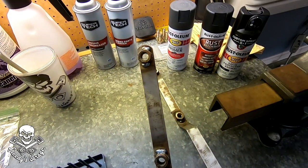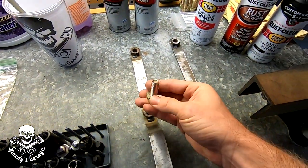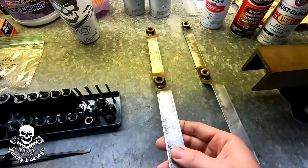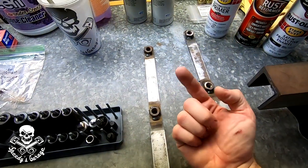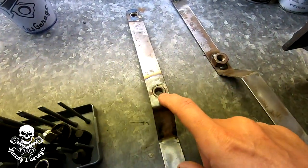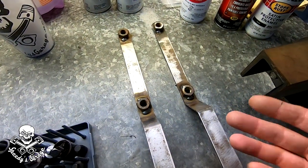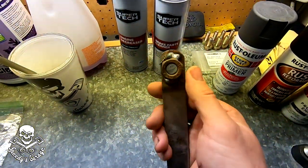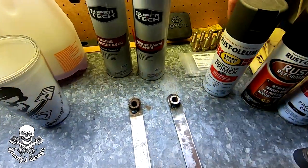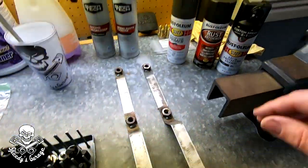These are the little brackets that go to the spare tire carrier — they slide up into the frame rails. I've already ordered new bolts for the tow hitch. These are 10.9, so I went ahead and upgraded those. I think the originals were only standard grade, and 10.9 is the metric equivalent of grade 8. These are the Z-bars that slide into the frame rail, and then the bolts come through the frame and connect up with these nuts to hold the hitch in place. A lot of people think these are welded on from the factory, but they actually aren't — they're just press-fit into these straps. I had a buddy of mine tack weld them so those nuts will never budge. I'm going to hit everything with anti-seize compound when I put the bolts back in, because the original bolts had disintegrated and the washers even fused to the bolt.